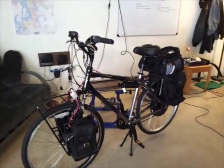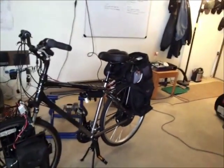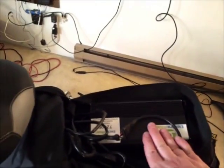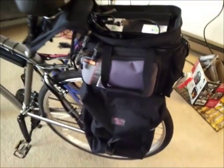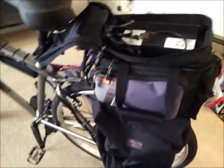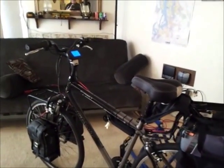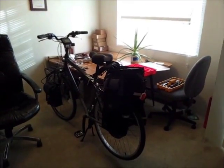Sealed lead acid batteries are not a good fit for big tall bicycles, but they'd likely work fine on smaller, lower mountain bike-style frames. With the old setup, even with my front mounting system, the vehicle was very shaky and wanted to jerk me off balance on sudden turns. But this 72-volt lithium-ion setup rides like a dream. The only issue I've seen so far is the controller gets too hot to hold my hand on, so on nasty hills I'll pop it open and allow the wind to cool the unit. Worth the investment — I'll track miles by odometer to see how many dollars I save in gas.